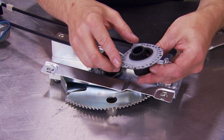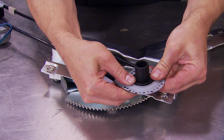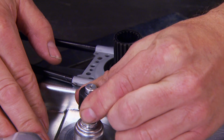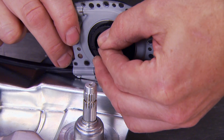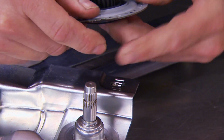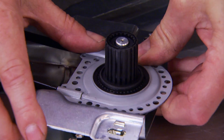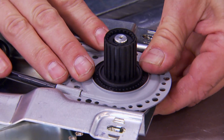We just got to build it as we go, then bolt it in, test it out. There are dozens of combinations of cogs and adapters, so if you take your time and do a little bit of trial and error, you will find out the combination that works best for your particular vehicle. Now, if you're thinking that these nylon cogs can get a little bit weak, well, think about it like this. It's nylon against nylon, the splines match perfectly, and there's only one point of contact with steel. There's not a whole lot of pressure on that. Everything else is cable-driven with an electric motor that matches. Everything is designed to work together as one system, so it's actually pretty strong.